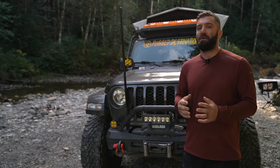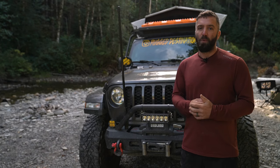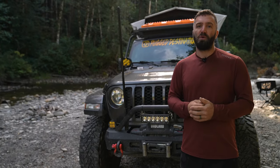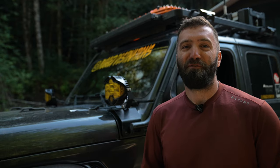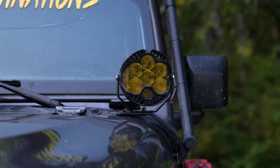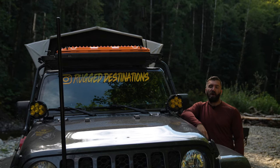The ON X6 is a very small light bar with very large output. I use this as a main driving light when we're off-road — it creates a very hot spot in the middle of the road right in front of the wheels and tires, which is where I need it. For ditch lights we are running the Baja Designs LP6 Pros. These are oversized for a typical ditch light, but I run them at an angle that makes them a hybrid ditch light and driving light, in amber color to help cut through tough road and weather conditions.